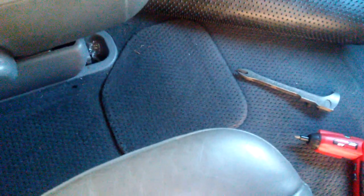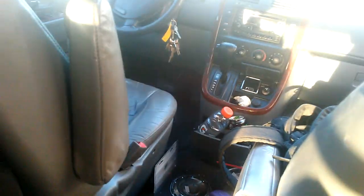The fuel tank pressure sensor is located right in the middle of the two sliding doors on the passenger side floor. You can see it from the front of the van right here. You see that little triangle-looking thing — you open it like this to the front. And then you see four screws right there. Those are the first ones we have to take off.